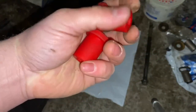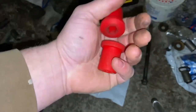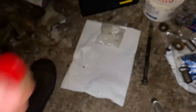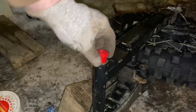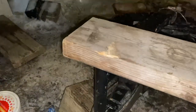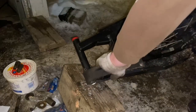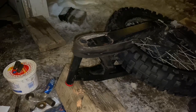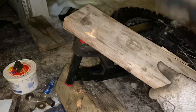These are the bushings we're going to put in the bike and overall I'm very happy with them — I think they're going to last a lot longer than the original bushings. These are simple to put in — there's no metal, so we just need minimal grease, and as you can see they're already kind of hand-pressing in, which is great. I'm going to take a piece of wood and just hammer these in. Then flip the swing arm over, do the same to the other side — get the bushing started, block of wood, hammer it in.